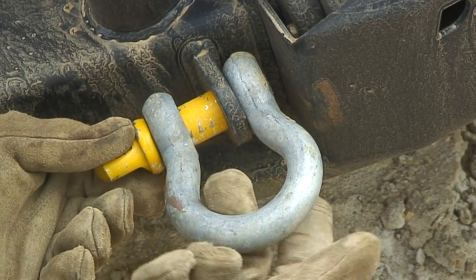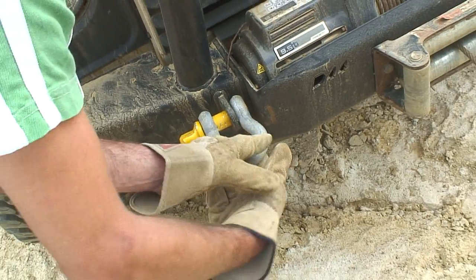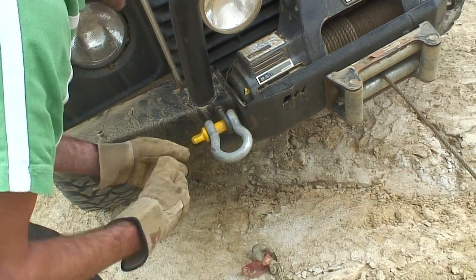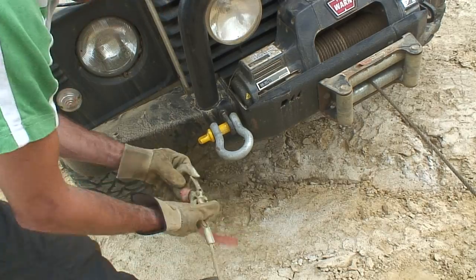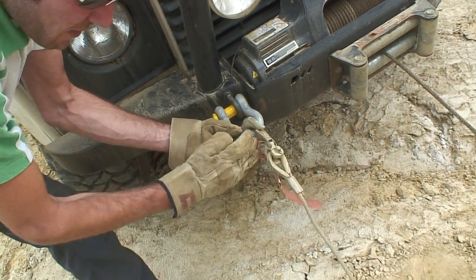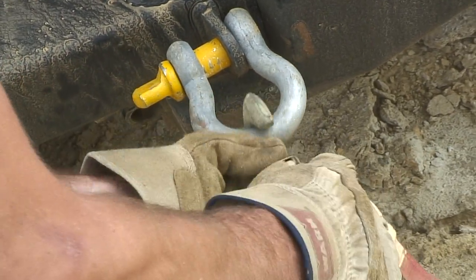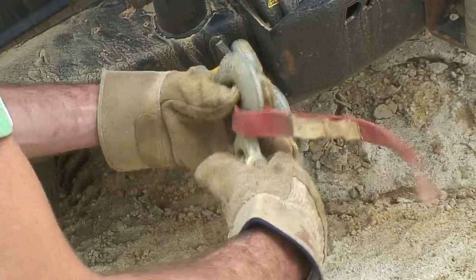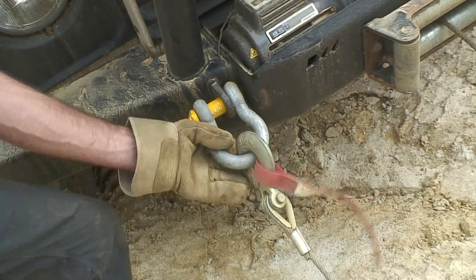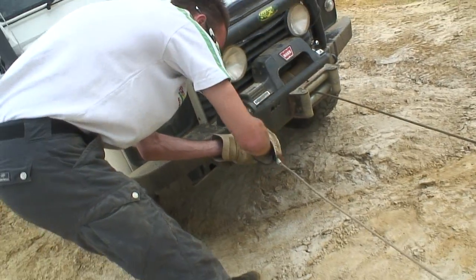Again here, what my hook can do is centralize itself in here, but ultimately the hook should be connected at the same straight line as the cable going into the drum. Now what I'm going to do is hook the hook from underneath and in. This way, if anything fails down here, the hook should hopefully go into the ground, rather than, and I think you'll all agree, visually, if it breaks now, it could actually go airborne, potentially giving us a bigger, wider range of danger area.